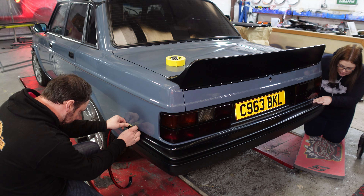We're not finished yet on this hack because it's not quite holding the boot up with one in - but it's holding it on one. That over there is the original 240 boot spring, that grey cylinder. Over here is a gas ram off an E30 bonnet - they only have one on the E30, that's how powerful that gas ram is. I've bolted it through with an M6 bolt and cut open the hole at the back so it can hook on. It's exactly the same length and slightly stronger. It holds! It never held before. We're going to pop another one on the opposite side and that's going to solve all our boot opening worries.